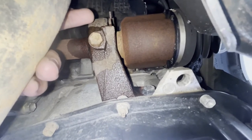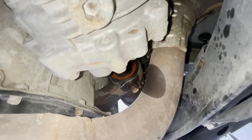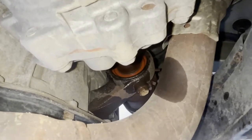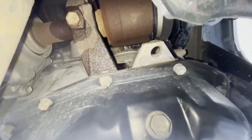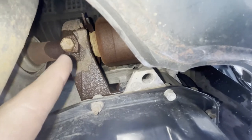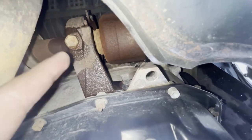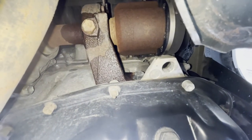If I can't get it out after I take the little snap ring off and loosen the bolt, what I'm going to have to do is try and take off the bracket — you can see the bottom of the bracket there and then there are two top bolts that are going to be very hard to get to. Hopefully I'll hit that with some WD-40, take the snap ring off, undo this bolt, and then whack it out of the transmission.